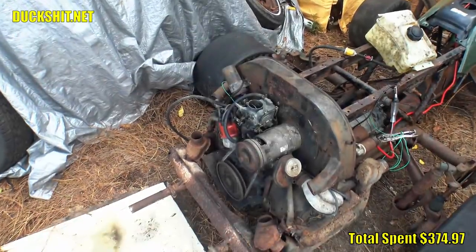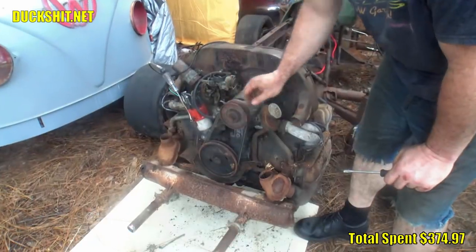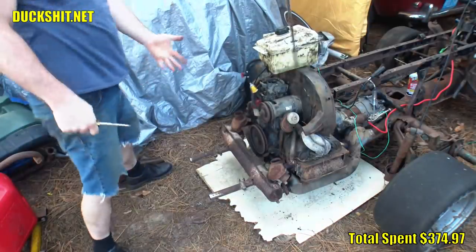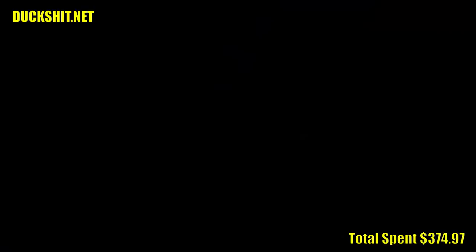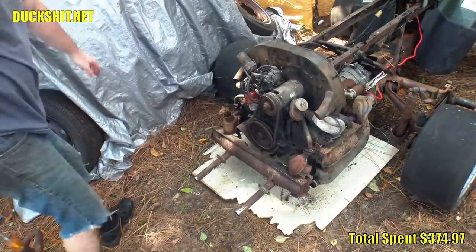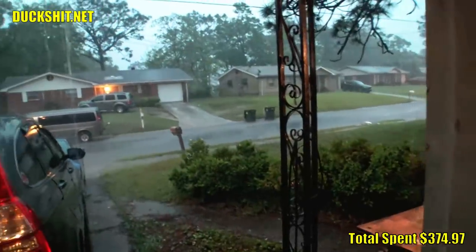Well, the engine was restarted, it ran brilliantly. I still need to replace the belt, which has been throwing pieces of itself off at me. And later when the engine is cool, I have to adjust the valves, which seem a little bit noisy on the right-hand side. Then I'll check and reset the timing as necessary, but we're off to a huge step in the right direction. Well, I had to take a short break, yes you guessed it, because of rain. What else is new, right?